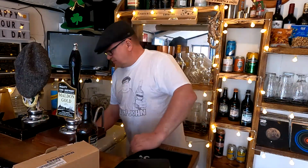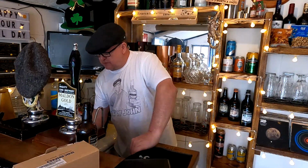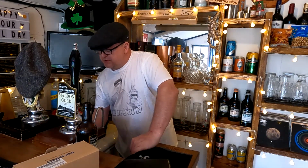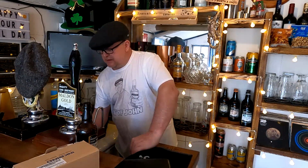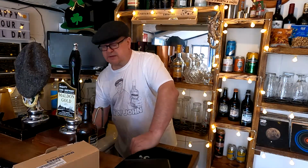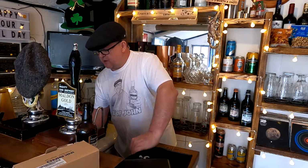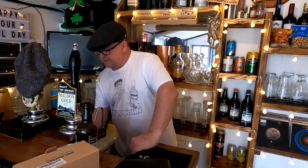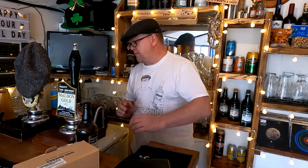Actually, let me have a look. You press the set button and hold it. Right, so 20. 2 degrees. So the high is 2 degrees. Low is 2 degrees. And then you've got an alarm on here. So the alarm is 120 because I haven't done that yet, and the low alarm is minus 40. So 2 degrees. So we press and hold to set it. So it's 20 degrees at the moment.